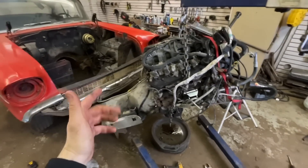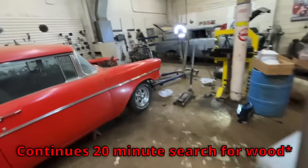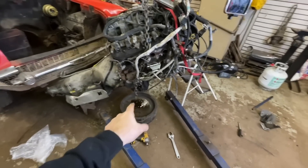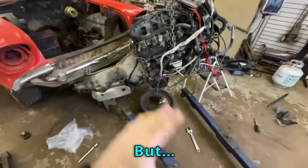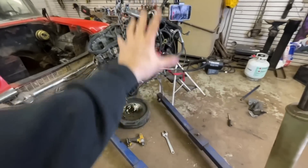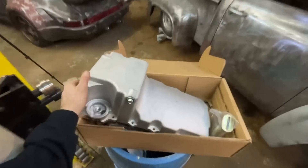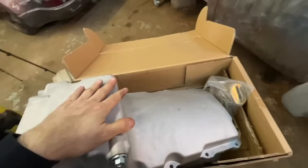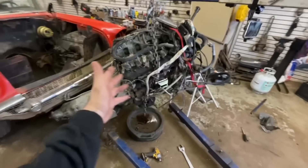She's out — actually came out very easy, knock on wood. I've popped a couple sensors off and I'm draining the oil now, getting ready to pop the pan off. I don't love working on it on a hoist, it's super shady, but I've got a couple safety measures just in case something goes wrong so it won't fall on me. We're gonna do this as quickly as possible. I just popped it open and took a look — it is really nice, like two inches of solid aluminum in some places, very heavy. It's one of the ones off Amazon and it wasn't super expensive either.